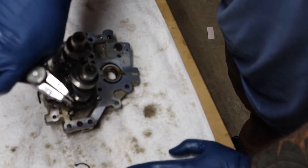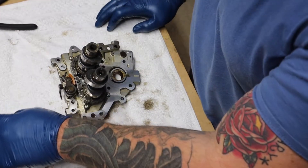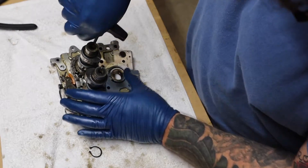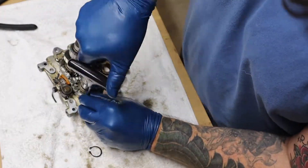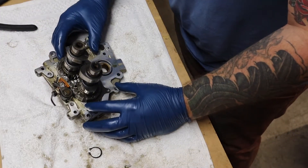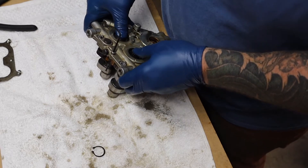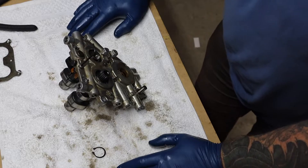It helps when you find the right tool for the job. Now we're going to take out these four T20 Torx bolts. This should be fairly straightforward. And this is the cam support plate — now that just pops out like that. There's your cam support plate. Now this is where it's saying you need a special tool to push these out simultaneously. I have a brass punch — let me try that.